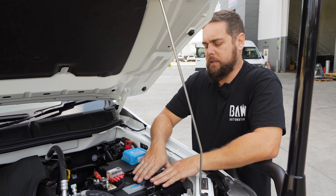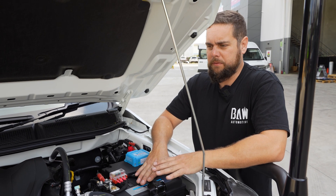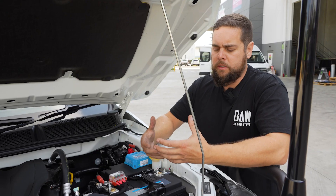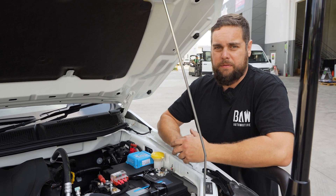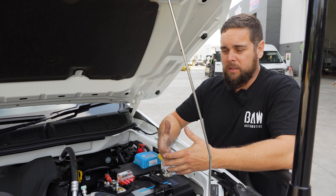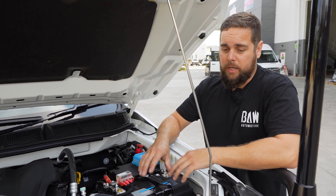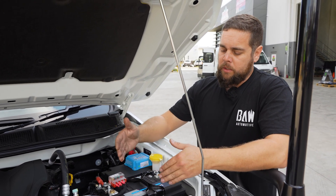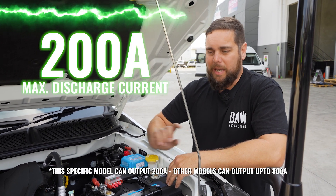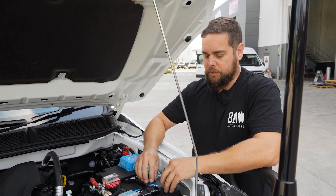In my opinion, these are great for the person who wants to use their car as a bit of a weekend warrior. If you're just running a fridge and a few lights, nothing too crazy, one of these is definitely going to cover all of that. If you want to run inverters and all sorts of stuff you might want to think about doing it differently — not that these can't do that, because they have a high output BMS in them. Depending on your model, these can put out up to 800 amps with the car off. It's ridiculous — these things have a huge BMS in them.